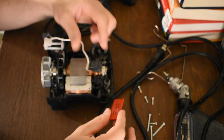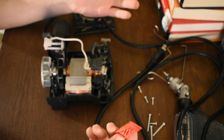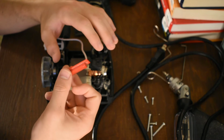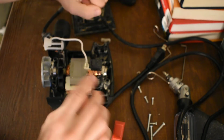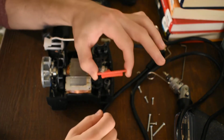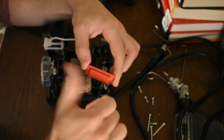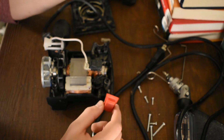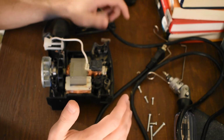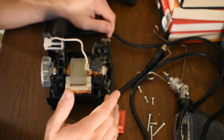It seats right in here. The mold is all designed exactly for the switch, and this actuates it. And you actually get a really strong snap action. So, I expected, because of this linear motion, that there'd be some type of linear side-to-side switch, not this rocker. But if this piece was shaped better, if it had more of a rise on the front so that you could push it easier, this would be smart. This would actually be a good way to save money, unless this fails. The thing is, they're switching AC, right? This is a commutated AC motor, and AC is really easy to switch.